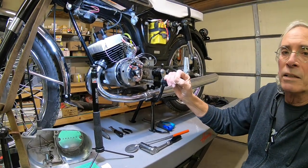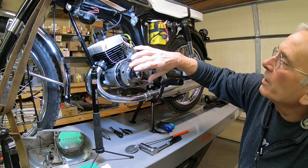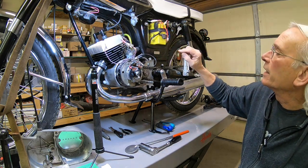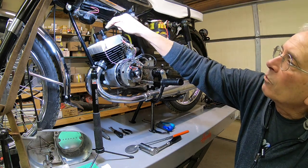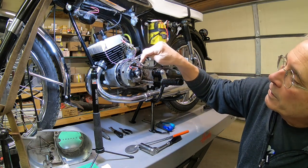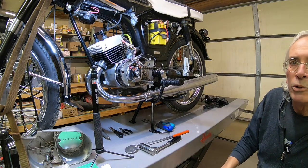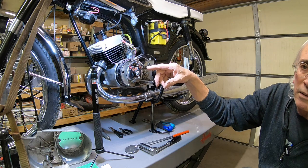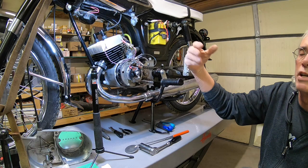Got it pretty much complete. Everything is the way I want it here. We've got all the wiring. I've got just my test light up here and we're going to go ahead and turn the power on and we're going to check when it fires and when the light comes on in relation to the magnet and the sensor on both sides. And then we'll go through timing. I've got it pretty close so I probably won't be changing it any, but I'll just go through the procedure to check it.